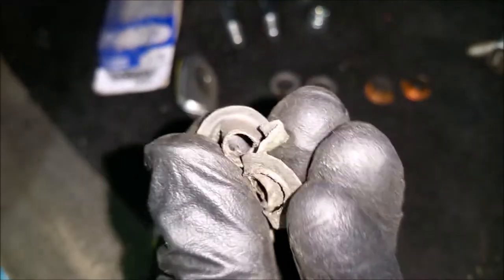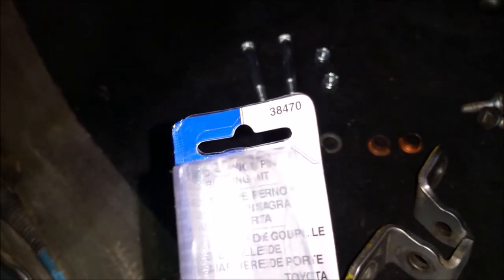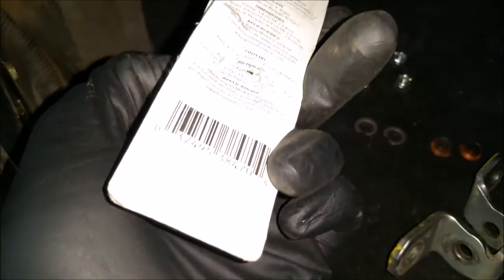These are the bushings that come out — these are plastic pieces of crap. Toyota quality right here. This is the same problem I've seen on the 350Z and some other Japanese cars. The kit for the Toyota Tundra covers the 2002 to 2006 range, and also the Sequoia 2002 to 2006. The part number is 38470, Dorman, in the Help section — you can probably get it at AutoZone or O'Reilly's.